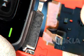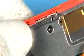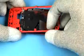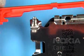Remove any adhesive residues from the opponent part. Keep these adhesives clean if this part should be used again. Carefully release the lower bezel assembly from the metal snaps of the slide module assembly. Shift the lower bezel assembly in the direction of the threads — it can be lifted up now.